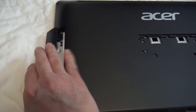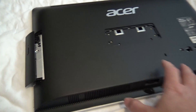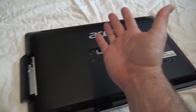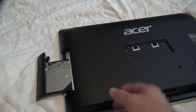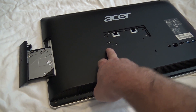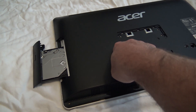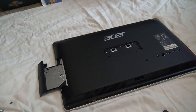Eject the drive and leave it out — push it to about a finger width. When you open the case, there are slide latches under the back, so when you lift it up it has to go this way and the drive has to have space. From the inside — which I think is another design flaw — that's when you remove your optical retainer screw. Every laptop build I've ever worked on, the screw is accessible from the outside; it is not on this model.